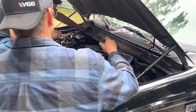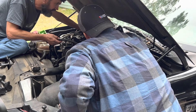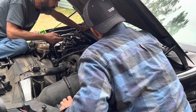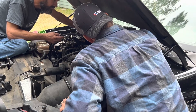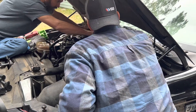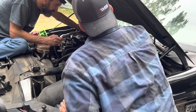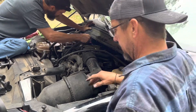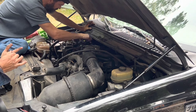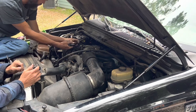So you're saying silicone up here — this is right here, right there. See that split? So look at that — it keeps water from running off of this and down into here, and it will force it to stay in this channel and come out the sides. Should I do some right here too in this little gap? I would — I would just silicone this all the way down, go across that hole. Isn't that stupid? Little thing. But it's things you won't see because you're not under the hood, and especially you don't realize it's a problem until it's already been in there for a while.